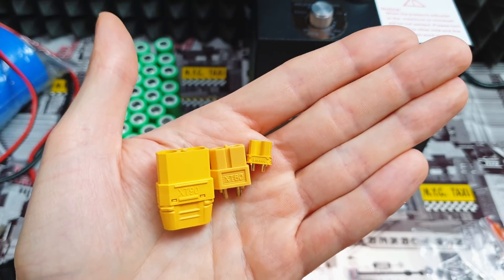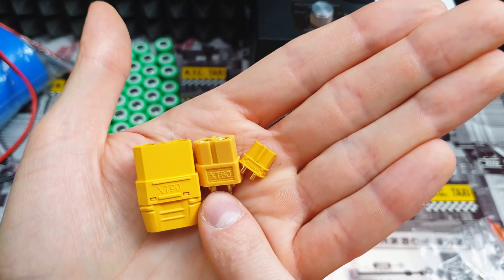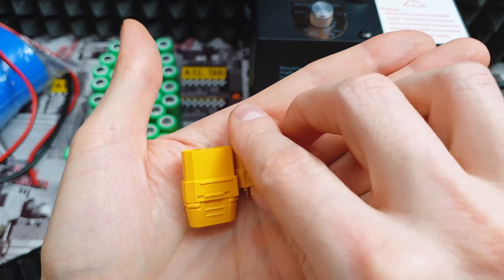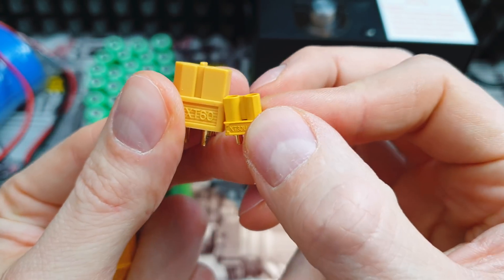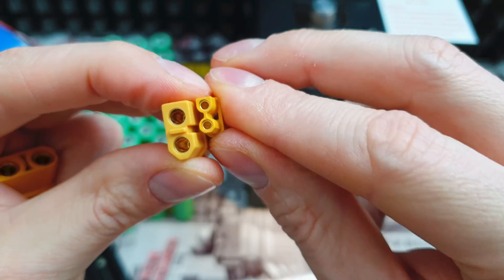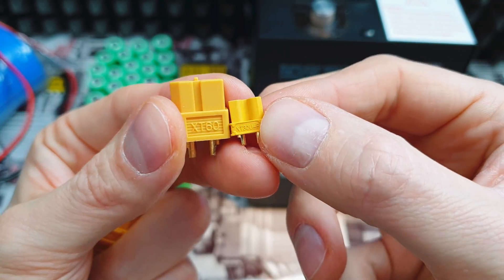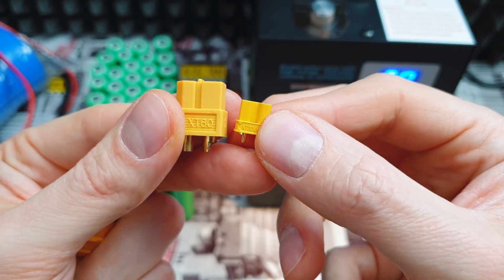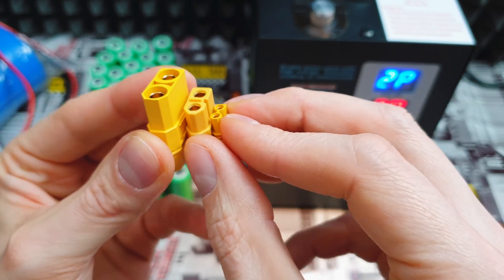Power connectors — this is the funniest thing. I saw so many videos on YouTube where people building extra battery packs say use only an XT60 connector because it's the only one that can handle the power. You can see the size difference between the XT30 on the right and XT60 on the left. But the XT30 can easily survive more than 30 amps at 40 volts — and that's exactly why Xiaomi, even on the pro version, still uses XT30 inside. So if you want to save space and weight, XT30 will do the job.